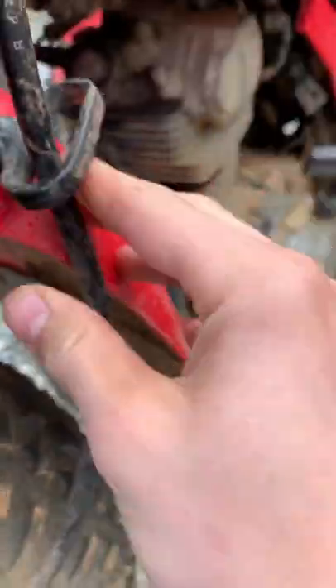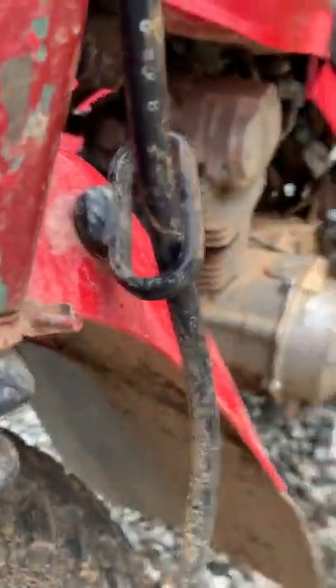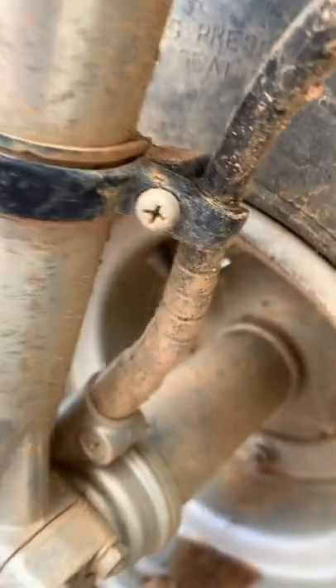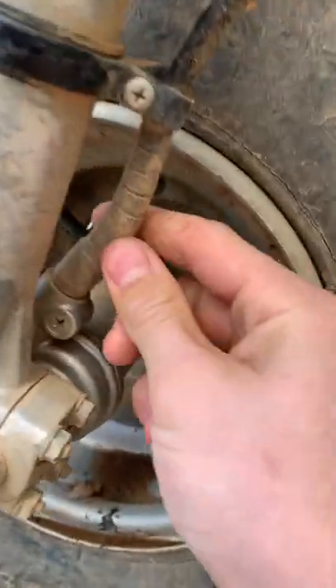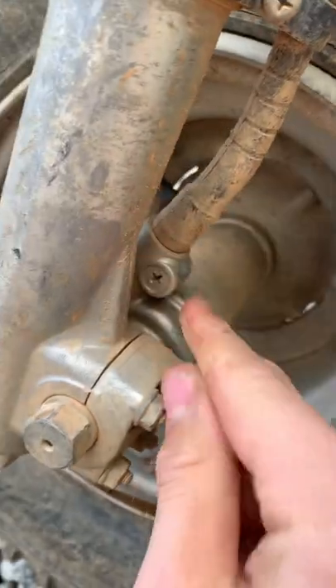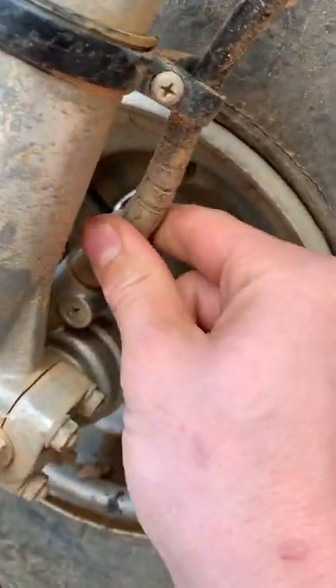It hooks into the fender at a little point — this little grommet goes in like that, right there. It pops in, you put that end on there and it doesn't come out — it keeps that cable in check. Then coming down here, you put on this small bracket that comes with it, just one screw. You slip it around the shock, then plug this in, tighten that screw, and you're wired up to go.